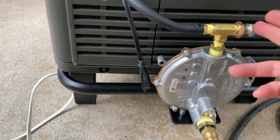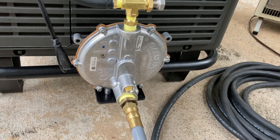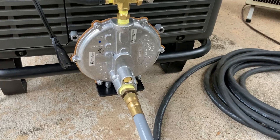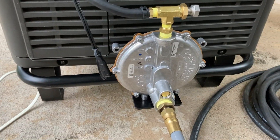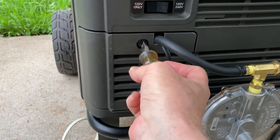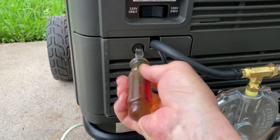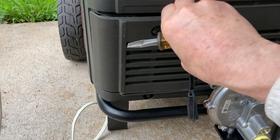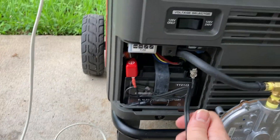I noticed that I can't turn the load block enough to make it too rich, so I feel like I'm probably short on gas supply at those higher loads. For anyone contemplating this kit, it is not a turnkey kit in my opinion.